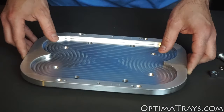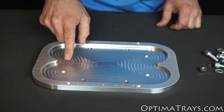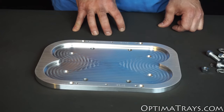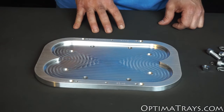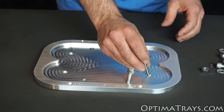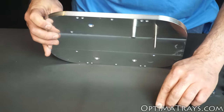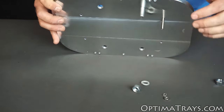Once you find out where your tray is going to install in the vehicle, look through the holes to see what you can drill, making sure that there's no brake lines or gas lines or electrical lines or anything else around that might get in the way when drilling. Once you've selected your holes, drop in the bolts, and from underneath you'll want to install the washer and the nut on either bolt.